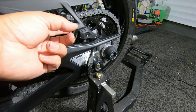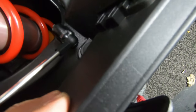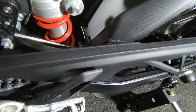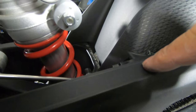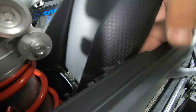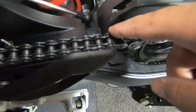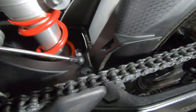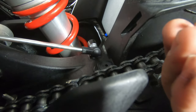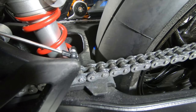Once you've taken the one off the swing arm next to the sprocket and this one in here, there's one last one — just down here, hiding — just there is another tab that we need to remove in order to take it off. In order to get to that bolt, what we're going to do is just detach the chain guard from the rear mud guard. There's a little clip — you need to put your hand inside the mud guard, squeeze the clip, and then it should just come out, and you can remove the chain guard as one piece. That gives you access to this little bolt here. Once you've removed that bolt — it's not actually a bolt, it's a twisted pin — just unscrew it a little bit, get something underneath it and pop it out. Now we've exposed some of the swing arm, give it a bit of a clean up before I put the new carbon fibre one on.